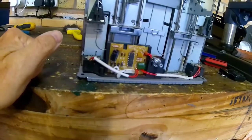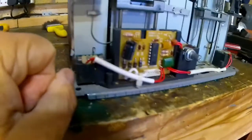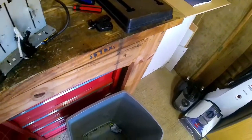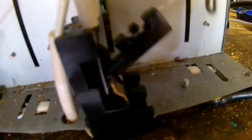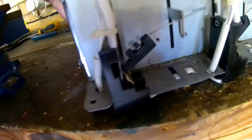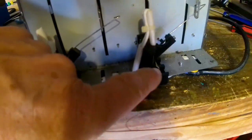The electrical connections sense that the toast lever has been pushed down. On the reverse side, there are electrical connections here and there, so when this goes down the connections close. What can happen is crumbs get in between the connections and stop them from closing properly. All the electrical connections here need cleaning and that's what I'm going to do now.